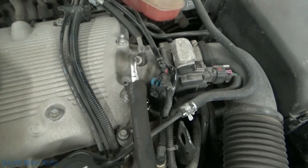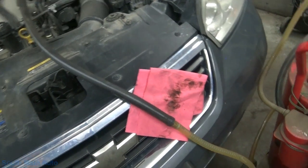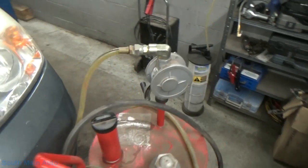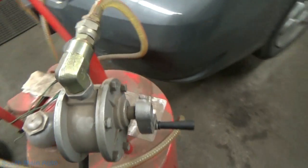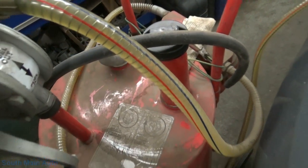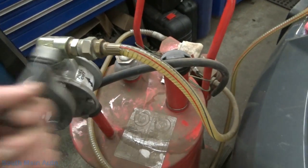Well, there we have it. Just a piece of heater hose that I kick around, one I use for flushing heater cores actually. I just hooked it to our pump inlet of the gas caddy. We can see the bubbles coming. It saves us a whole bunch of cranking.